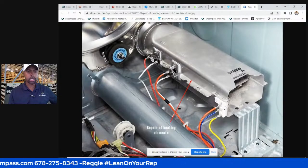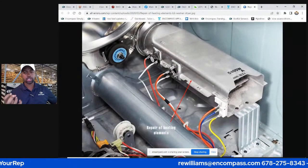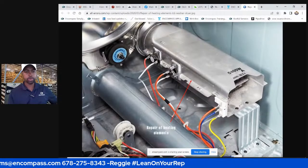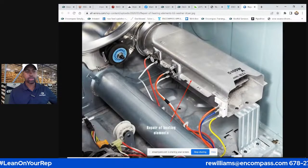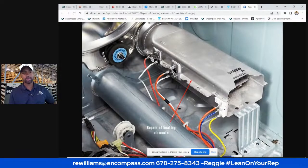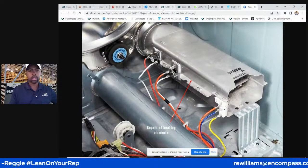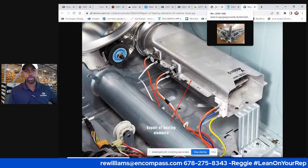Always a good idea to take this off. You never want to put grease on these things because it'll catch all the lint and hair. But what I do is I'll put motor oil on a paper towel and wipe it with motor oil, because motor oil is rated for higher temperatures and it's designed to bond to metal. So I always thought that was best. Some people use different lubes, but I feel like motor oil is almost best for me. Some people don't put nothing, they keep them dry. So, to each his own. That's pretty simple for the dryer aspect of this.